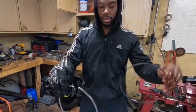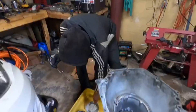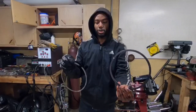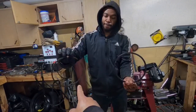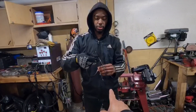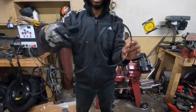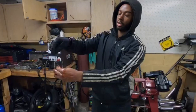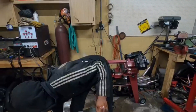They have these bigger snap rings — a lot beefier. You have two options: the upgraded snap ring that comes with the kit, and a spiral snap ring which is the aftermarket option and supposed to be a bit better. The spiral snap ring doesn't have an opening, so it can't flex open under pressure like a regular snap ring can. It's almost like a full seal, so we're going to go with the spiral one.